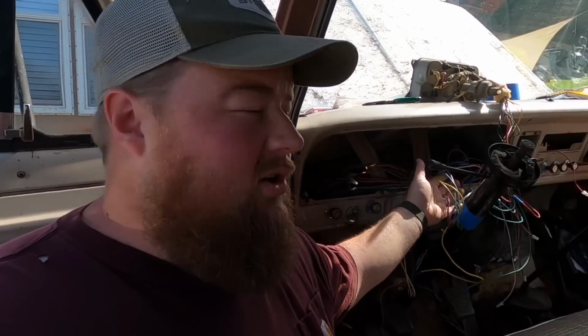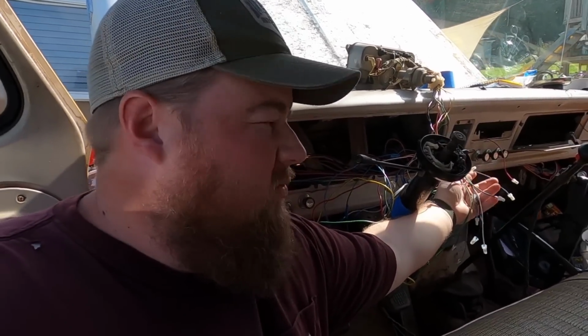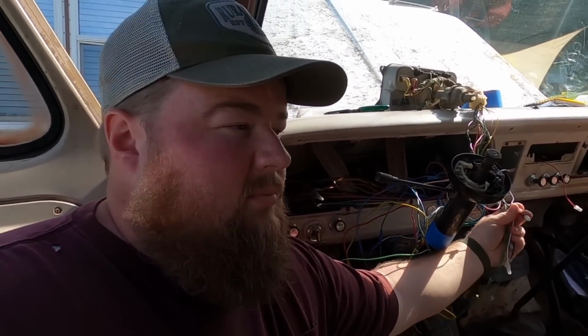While Angel's working on that, I'll go ahead and show you guys the cab as far as everything's connected. It's not put up yet, but all the wires are connected where they need to go. Any extra ones have these little wire nut clips crimped onto the ends, so they are safe, but still here if anyone ever wants to use them in the future. Things such as air conditioning and electric cooling fan switches and radio, dome lights, all sorts of stuff like that. Things that we don't have or aren't wired up.